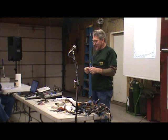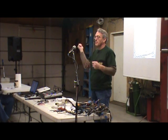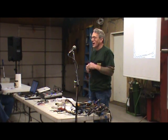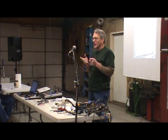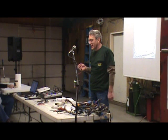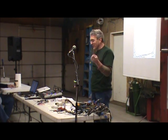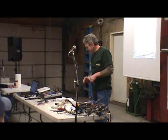And a funny thing was, I put this together as show and tell, and I pulled it out this morning, and I stretched it, and it popped. It came right apart. That's how good it is. I mean, all you've done is twist a couple of pieces of wire together. You didn't do anything to try to make sure they stayed together. You're just relying on friction to hold them together. It's a perfect place for corrosion to get in. You pull on it enough, it will come apart like that. This is garbage. So don't do this. This is bad. Don't do this.